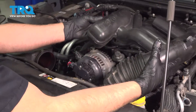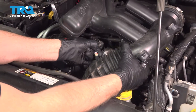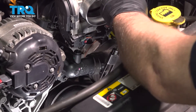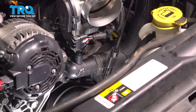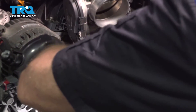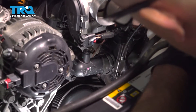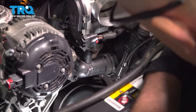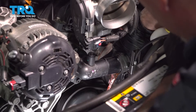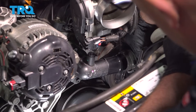Just twist it up — there is a connector underneath, so be careful. Don't pull the wire too much. Just push down on the tab and disconnect that connector. Now using some hose clamp pliers, you wanna move the hose clamp and you might lose some coolant, so just put a drain bucket underneath. Grab the hose and twist it back and forth a little bit. Drain that coolant just a little bit, not too much.